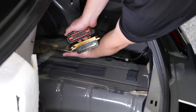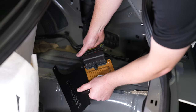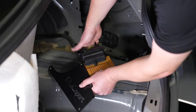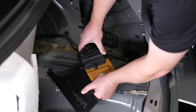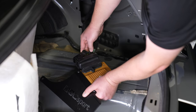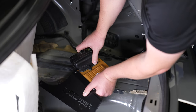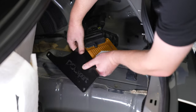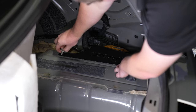Check the pins and make sure everything is lined up. Carefully push the connector into your controller, then pull down on the lever and let the clip pull the entire connector into your controller. You'll hear it click once it's latched. Then you're ready to bolt down the bracket using the factory hardware.